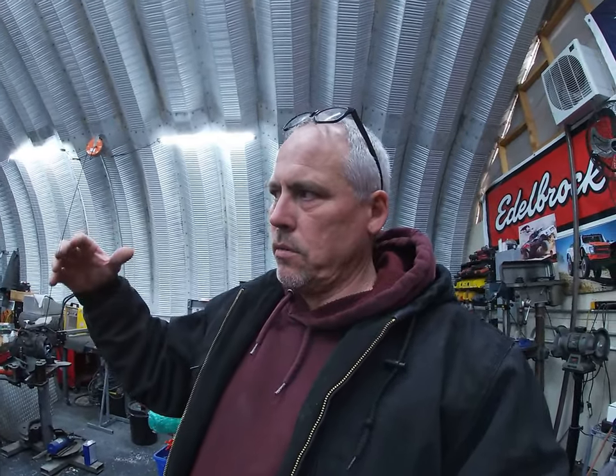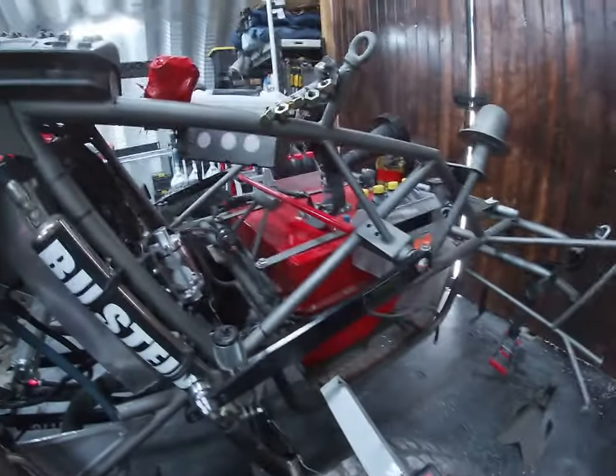plastic, wire-embedded liner bladder. It's just the next level of protection in case we get in a bad crash and the cage rolls in on itself and that big red box gets smashed. The bladder just conforms to the smash, and if it doesn't get punctured, then you don't have a fuel leak. And then inside the bladder is a bunch of foam that prevents the slosh of the fuel. So it's a pretty elaborate system inside those fuel cells. I've never torn one apart, so I'm a little nervous about doing it, but I think it'll be all right.